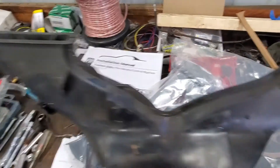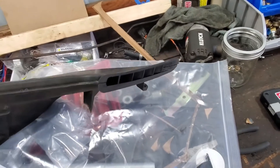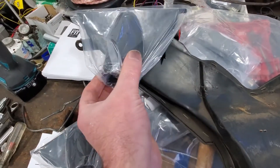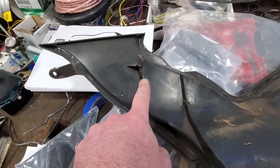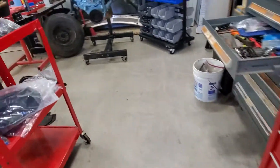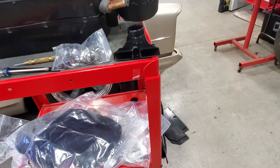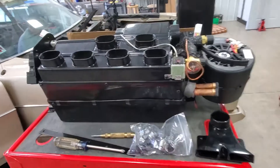Here is the factory defrost vent with the two location holes that we'd like to reuse. We'd really like to use those spreaders too, but the rest of it obviously we can't. These are the generic vents with the standard inlet — we can probably come up with a way to epoxy those just below those vents, make that one piece so we can still use the hoses. This also comes with remote vents for your feet — anybody familiar with stock GM knows it jumps right over the hump and that's it. So we've got two of these vents and we've got to figure out where we're going to run those as well.